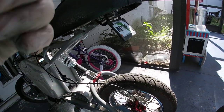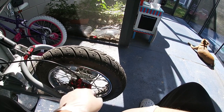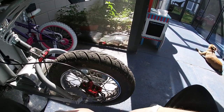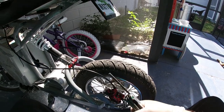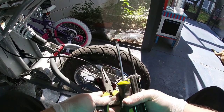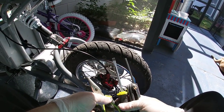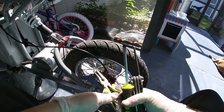Welcome back to the channel. I'm going to show you guys how to change the brake pads on your Zoom four-piston hydros — we're going to do this really quickly and easily. All you're going to need is an Allen key set, a flat head, some needle nose pliers, and I would also recommend some latex gloves to keep your hands clean.